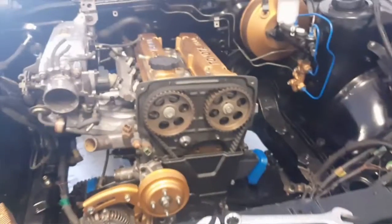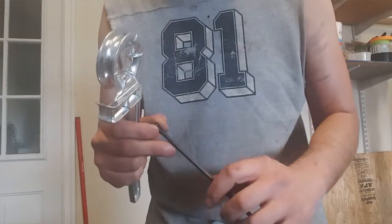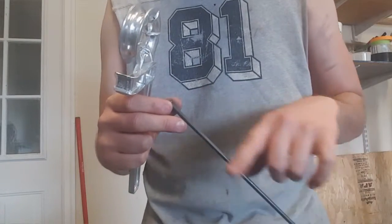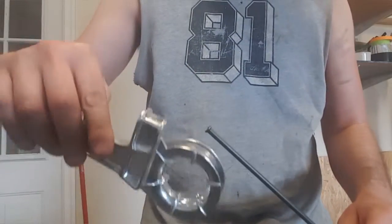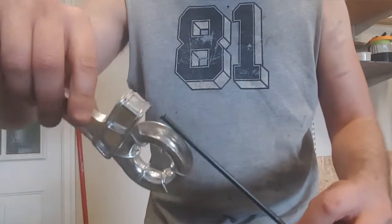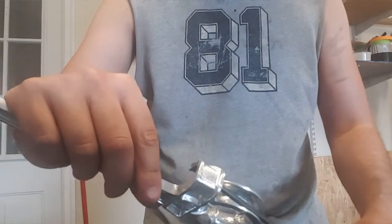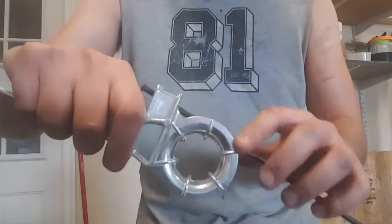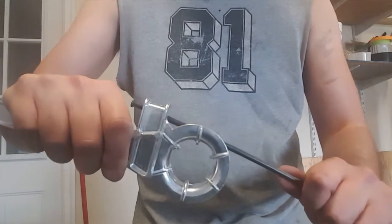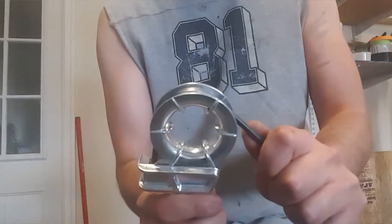So we saw on the master cylinder by the firewall — the bend we're going to need is pretty much almost like a 180-degree bend going upwards. Basically you just take this, it's got this rounded piece right here, and this little arm right here that will hold the brake line. You're going to just bend it right around the piece. This stuff bends pretty easily too — just like that.